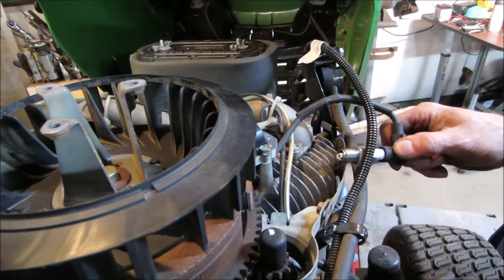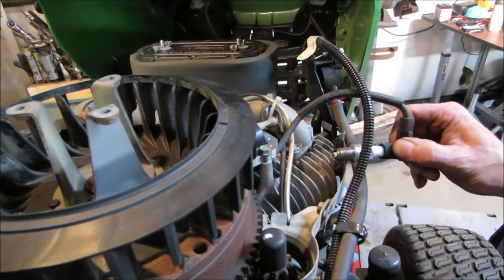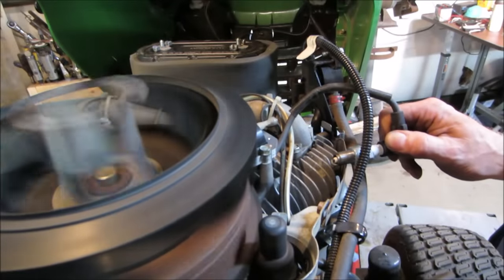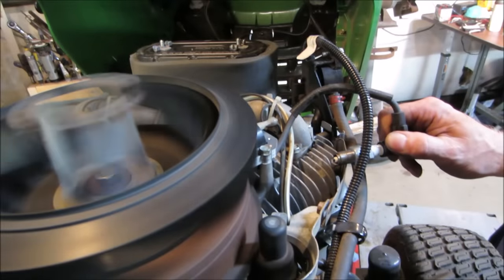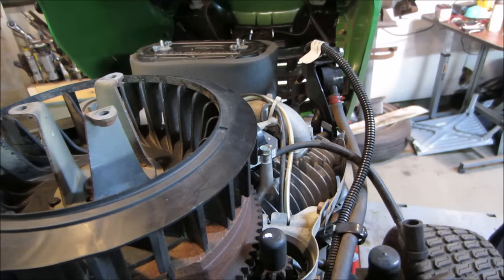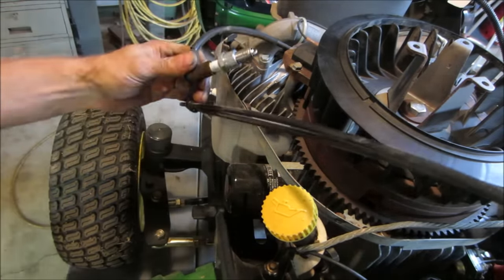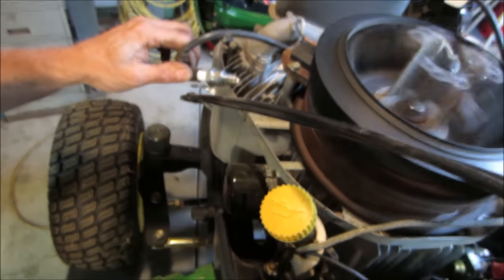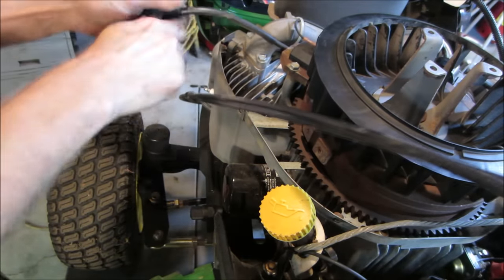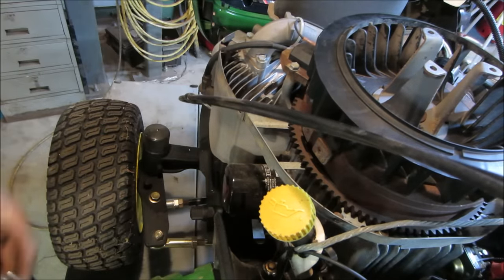We'll give her a spin. Yeah, it's got spark, a little on the weak side. Now it's got nothing. It's kind of crappy, actually. I'm gonna go check the other side with the same plug, see how it looks. Yeah, that air gap looks about the same too on the coils. It's an aftermarket coil. Let's see what we get on this one. Definitely more consistent. I say you just run it. But if we have a cylinder that's dropping out, I know where to blame it already.